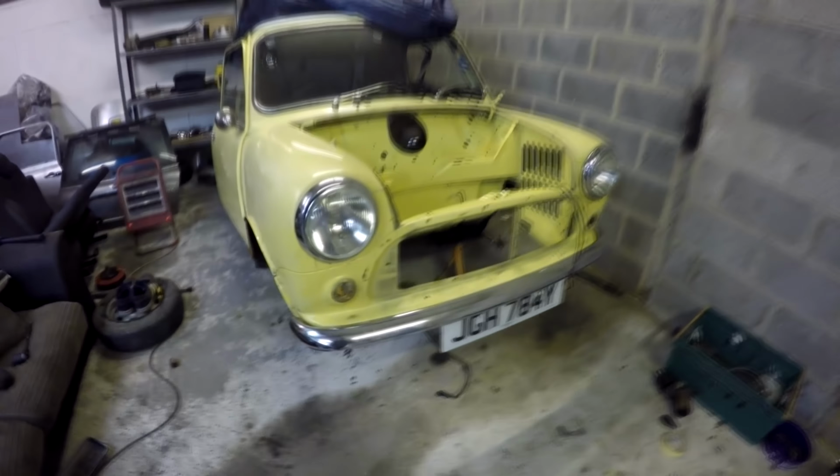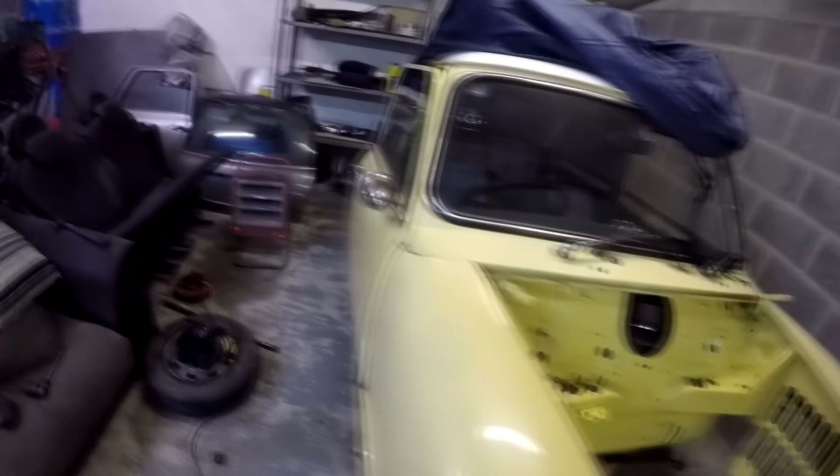Okay, so we have got the steering rack bolted in. That wasn't without some dramas though. Where's the other inner column gone, James? There it is. I don't know if you'll be able to see that. The splines clearly weren't engaging very much, and what was there is very non-existent anyway, so that's not great. I did have a spare inner column, which we have messed about with, installed, put new bushes in and everything, so that's great. Bit of a pain, but hey-ho.